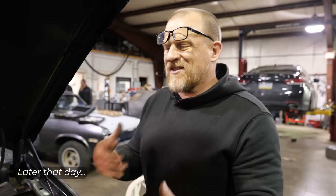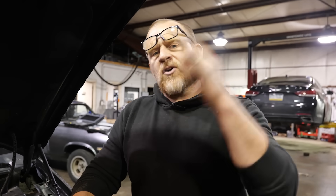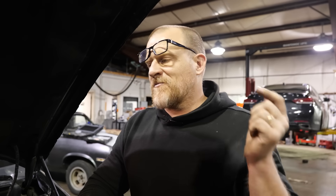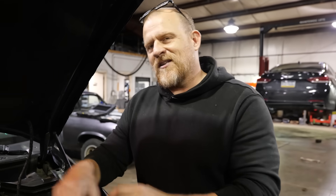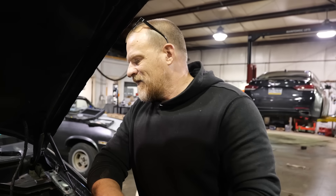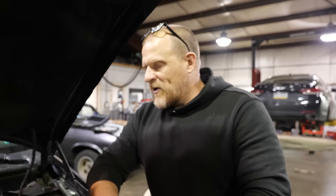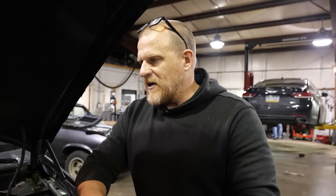I'm really glad we did the Swaptronics with the O2s because now I would be circling back to that. I'm glad we checked hydrocarbons and restricted exhaust — we've checked those off our list and I'm confident in those checks. I thought it was clear at first, but as it ran I wasn't so sure anymore. That's the way troubleshooting is. If the balance test isn't fruitful, the next step is going to be engine mechanical stuff — compression testing, running compression, those kinds of things.